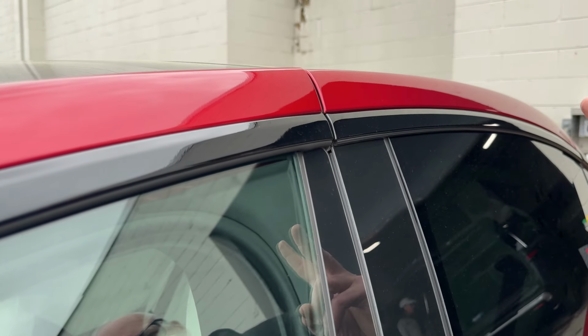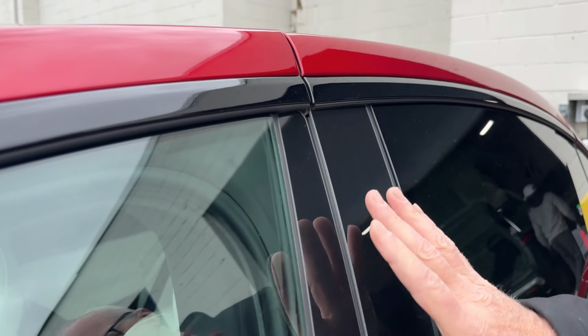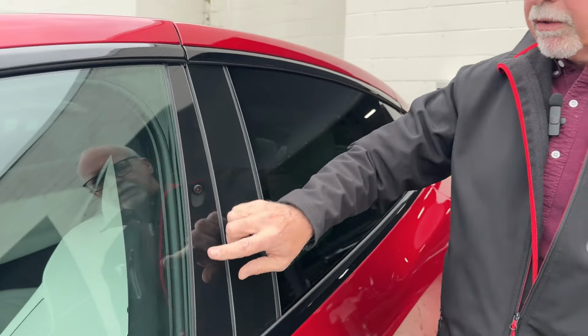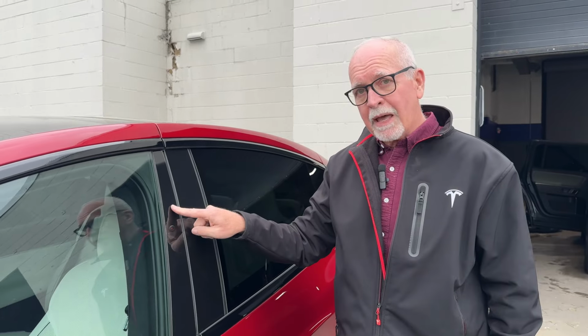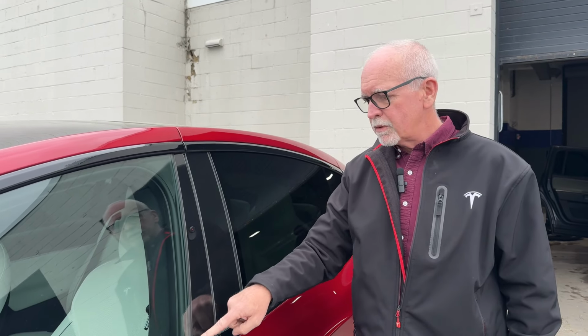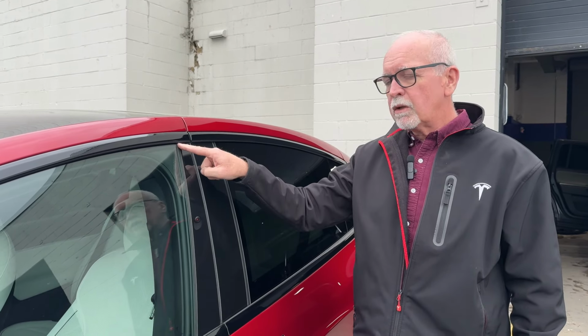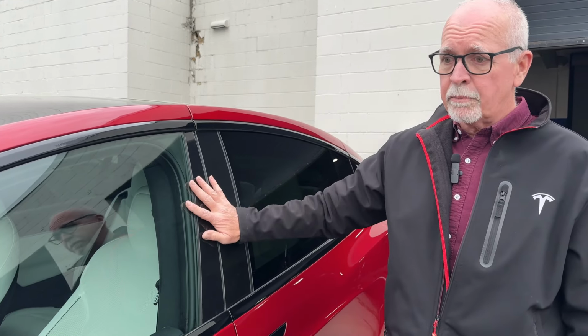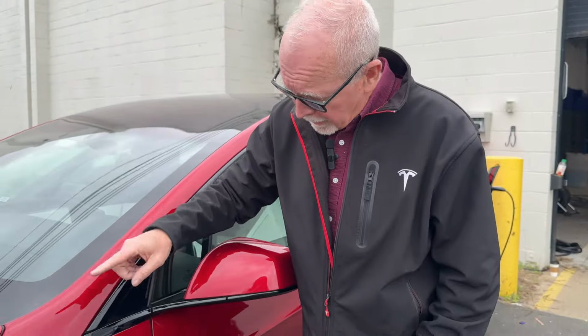So this is, I've got another V gap right here. Could it be adjusted? Certainly. But you've got to understand the compromise when you start to adjust the panel like this, where you have weather strips. So there's a weather strip here along the edge of this panel. If you start to mess too much, the compromise is wind noise. So no easy task to body fit, but let's go forward and take a look at the body fit issue here.